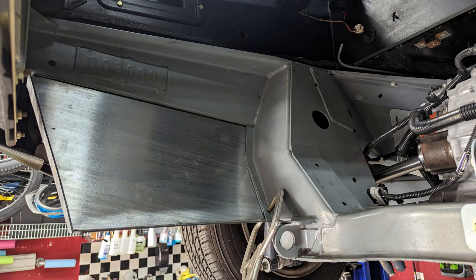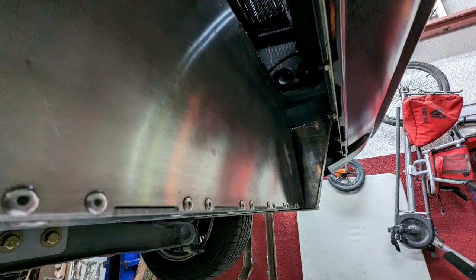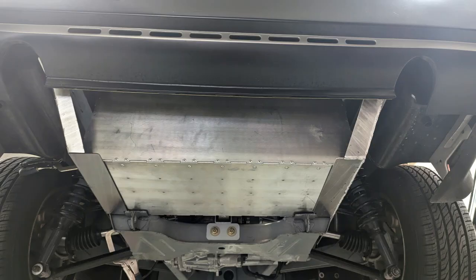For the lower aft box, I knew I wanted to drop it down deep into the frame, but I did not want to just hang it off the cantilevered frame rails. So these gusseted mounts that double as bodywork for protection for the boxes fit the shape of the frame really nice, and I angled it back up to the tail. These not only gusset and strengthen the frame, they support the battery box, and they also provide protection as bodywork. This worked out really well.